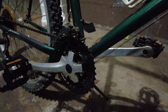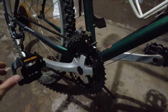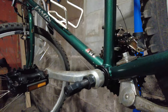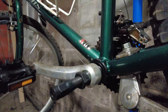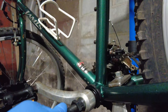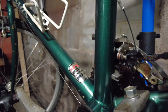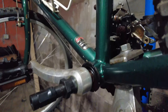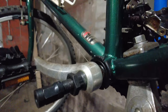This bolt looks rusty but it's only surface rust, thankfully. The next step is to take the square taper bottom bracket out and inspect it, because I'd assume that's the area most damaged since the whole thing is wobbly. I'll try to take the non-drive side crank out — the bolt looks rusted but is surprisingly in good condition, so I was able to smoothly insert my crank puller. Fingers crossed that nothing is too rusted and we can salvage this bottom bracket.